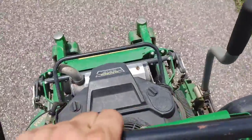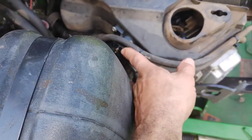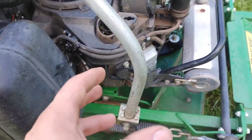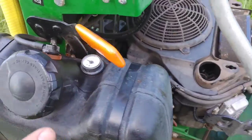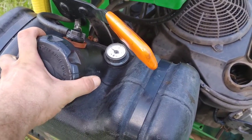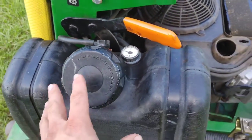When I did the fuel system clean I recommended just cleaning the thing out, and the customer said go ahead and put a new fuel pump on there, so we put a new fuel pump on there because that sand will mess that up. I blew out all the lines and everything, went ahead and dropped the bowl on the carburetor, and it did have a little bit of contamination in there but it was running really good. So I knew it wasn't really a carburetor issue — when it was running it was running good. Valve issues and carburetor issues I wasn't concerned with. It would just start starving for fuel after about an hour or so.